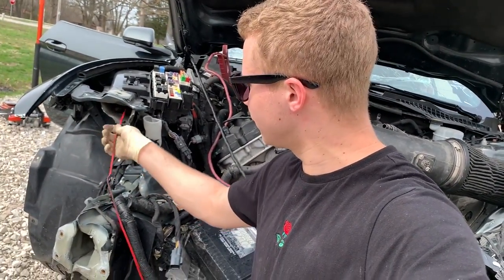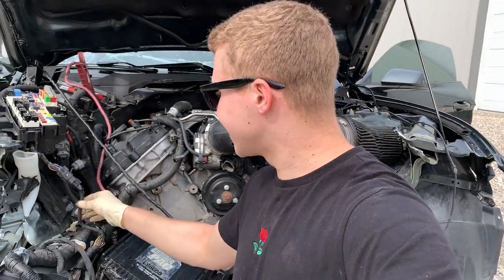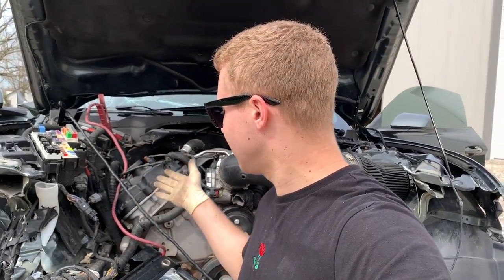It went down through the pillar, as you remember from the last video, it was in there. I practically just snatched it out last time and it came out, but technically inside there was some kind of switch where you just turn it on and off, and if you turn it on, the car won't start. If you turn it off, the car will start. Practically a cheap security system. I got it disconnected, got the wires connected that were holding on to this, and now the car starts without any issues.